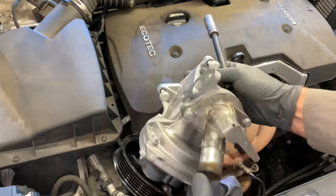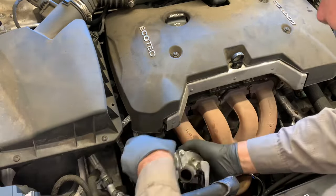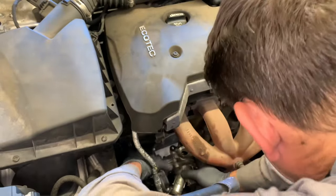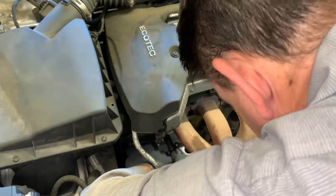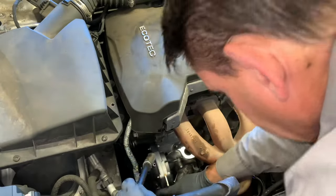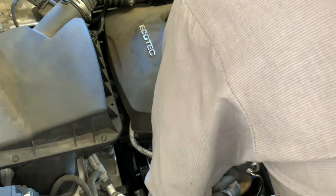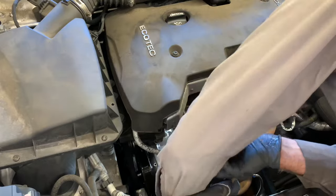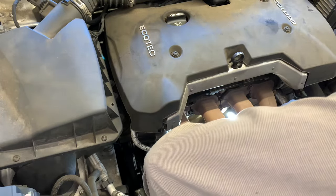The pump comes with all the O-rings attached and new bolts already on it. Slide the pump down into position and start all three bolts by hand — start each one a few threads so you can wiggle the pump to help line up the bolts. Once all three are started, run them in until they're snug against the block. I ran the bolts in with a cordless ratchet slowly until the water pump was just snug — I didn't fully tighten with the ratchet. Power tools are not required.